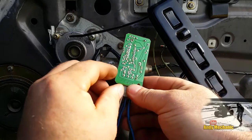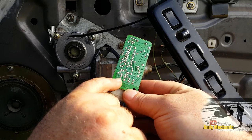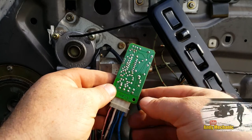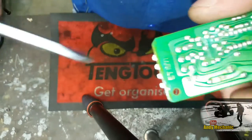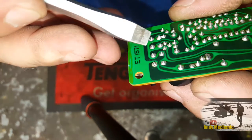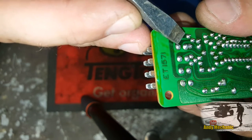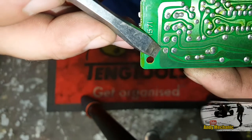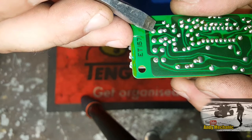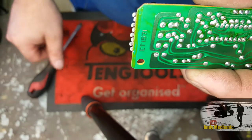I'm very happy that I found that. Now there is also another joint here that just looks like it's starting to fracture, so I'm going to re-solder that one at the same time. You can really see that - I'll do a good close-up - you can see just how burnt it is. It's been arcing for a while. That looks great and I'm surprised I didn't spot that yesterday. I'm hoping you can see - that's the joint that was sparking earlier on, and that's the one that's just got a little crack around it there. It's been melting the solder away.